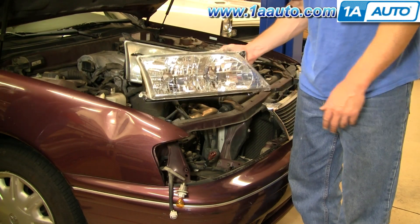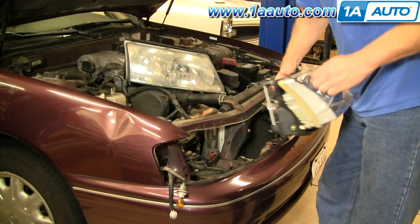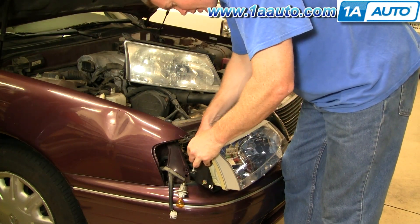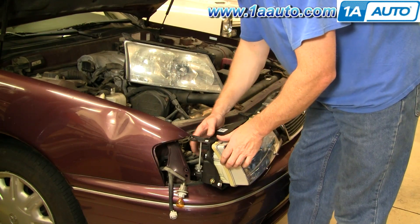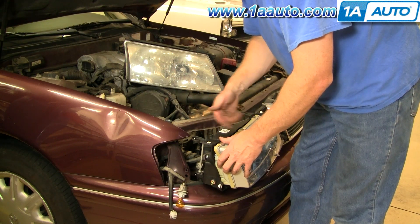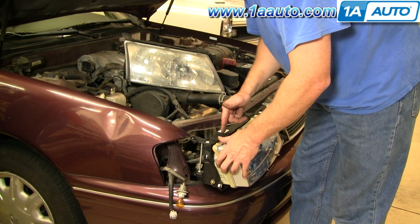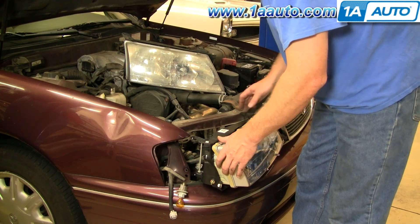It's going to make your car look nicer as well as help you see better at night. I'm just going to have to peel some of the plastic off. Right in, and connect our bulbs. As you're putting it in, you'll notice there's an adjuster screw here and there's also an adjuster screw back here. Basically, park your vehicle 20 feet away from the wall, then use the adjuster screws to aim your beams — one adjusts up and down, one adjusts left and right. You want the beams pointing straight forward. Your low beam concentration should be one inch below the height of the bulb, 20 feet away.